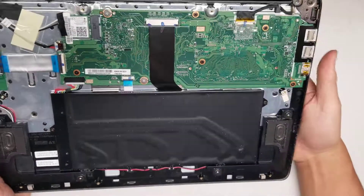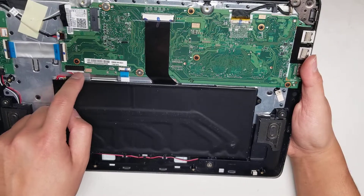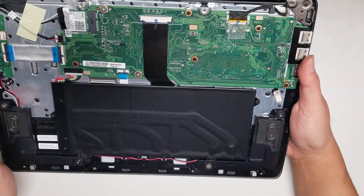You've got the battery here. If you want to work on computers and start taking things apart, it's a good idea to disconnect the battery first to be safe and then hold the power button.